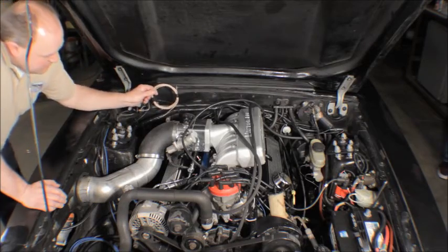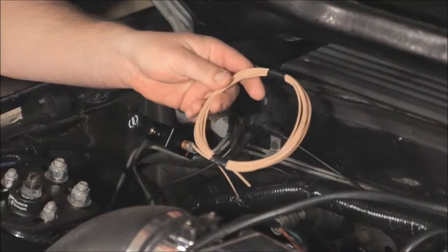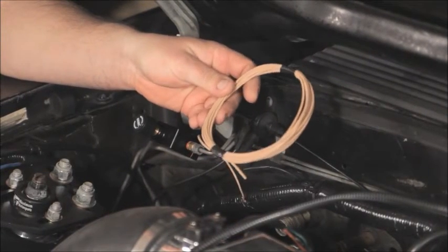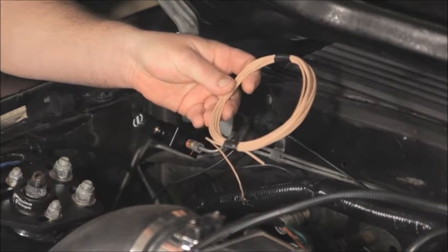This lead is used to control the nitrous system. The Pro-M EFI processor can ramp the nitrous up gradually while ramping back the ignition timing, all with easy to set parameters in the tuning software. Look for a video on that on our website.